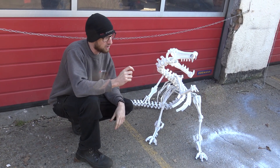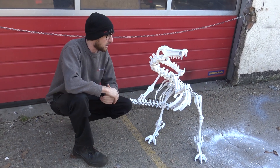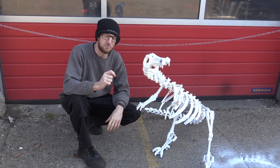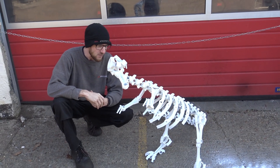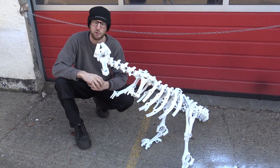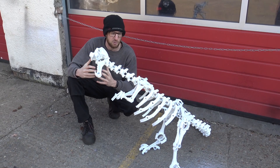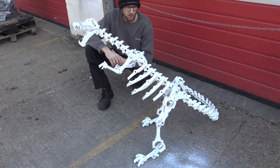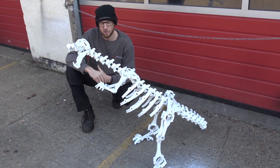They're a very old-designed one-piece steel rocker that came about donkey's years ago, and had an extra oil hole in them to feed oil on top of the valves for lubrication. Unfortunately, that meant engines burnt oil like there was no tomorrow, because we didn't have neoprene valve seals — and even then, they're not designed to have oil squirted on them like these rocker arms did.